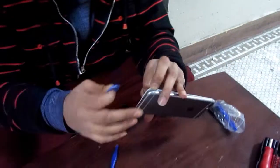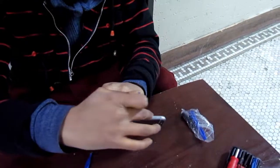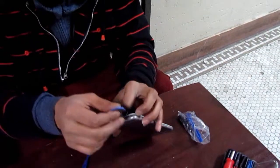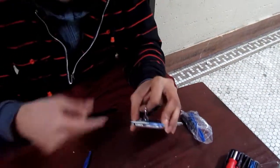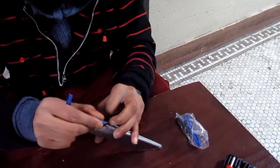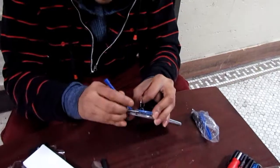So basically, just by removing those two screws it's already open. After you remove those two screws — now this is the iPhone I opened before; usually there would be some glue around the sides so it'll be a little bit harder to pry open. Basically I got that corner open, now I want to work on the other side so I'm going to leave the guitar pick there — the guitar pick flew out. Leave it there so I can work on opening the other side.